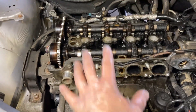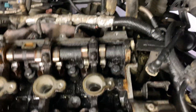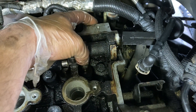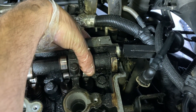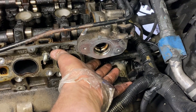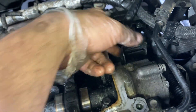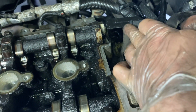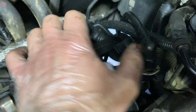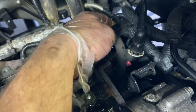Almost got the head ready to come out — I've got everything mostly disconnected. A couple of things to keep an eye out for: there's a ground wire that goes back here you've got to pull out; underneath that is the cam sensor with a 10mm bolt; there's another cam sensor to pull out; and there's a PCV hose connecting to a little module. There's also a loop with the wiring harness inside — I took the harness out of the loop instead of unbolting the bracket.